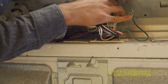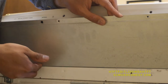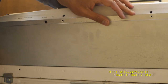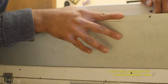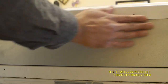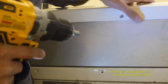The timer feels nice and securely in, so we can go ahead and put that console back in. You want to start by putting the lower portion — the silvery part — into its grooves, lining it up with where the drill holes are at, before then putting it underneath the white upper portion. Now we've pushed it back down into where it needs to be, all the drill holes are lined up, and I'm just finishing up tightening that console.